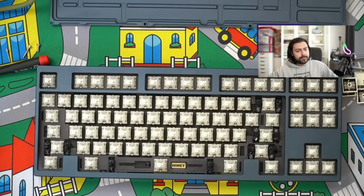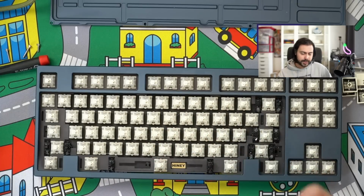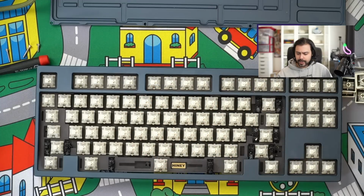I typed on this for more than 4 weeks. I just kept typing on it, and I've really enjoyed it. It's loud. For example, compared to the RU65, which is what I'm typing on in the office currently, this is louder. You can hear this from across the office. And of course, this is a half plate. So typing on PCBs directly is going to sound a lot louder than going through a plate. I was using ABS keycaps, not PBT, which are going to sound a little bit louder as well. But I love the boominess. And again, a little bit of brass on the inside would have really been good.